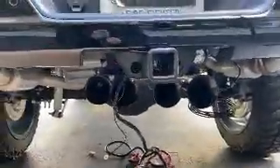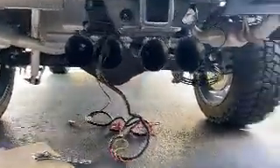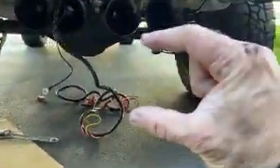So we have these installed and it is beautiful. I had to make some modifications. This is David with Power Call Sirens putting the Hornblaster Nightmare Edition 224 in. As you've seen in the previous pictures, we had some issues with it meshing on the frame. What I ended up doing, instead of extending those feet, I used four pieces of wood. If you look under here, you can see I have put two pieces of wood in that frame, and those feet match up with the wood beautifully. And then on the other side, I've got another piece of wood in the frame piece right behind the spindle for the spare tire, so those two feet match up perfectly on that frame.